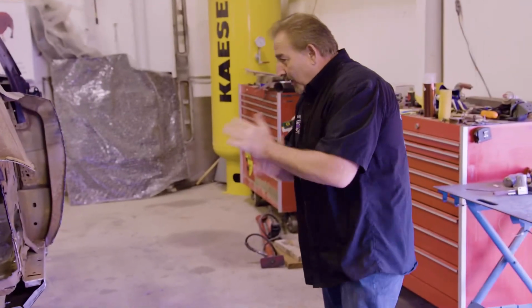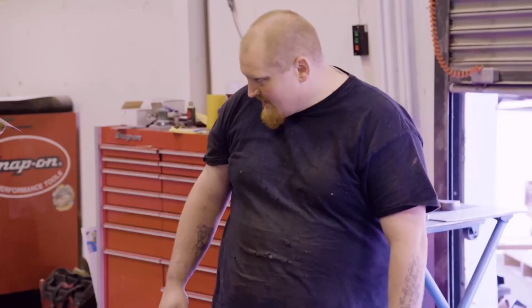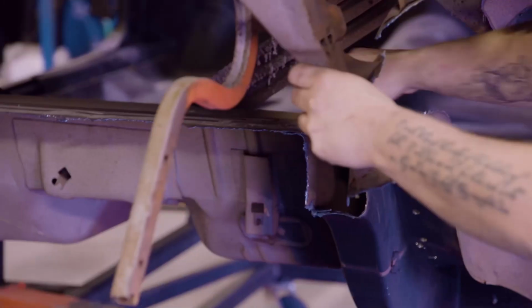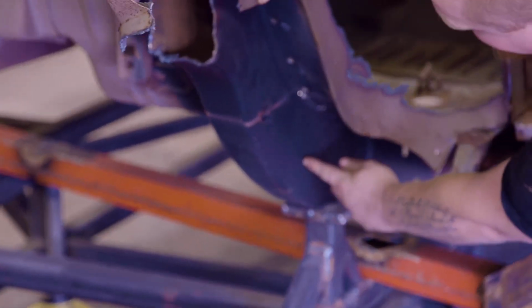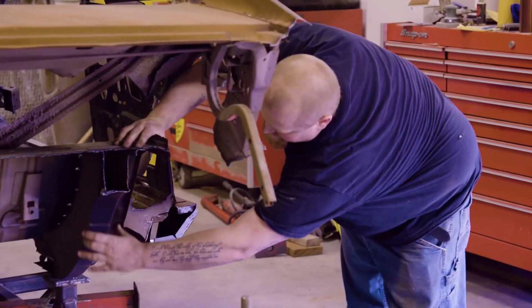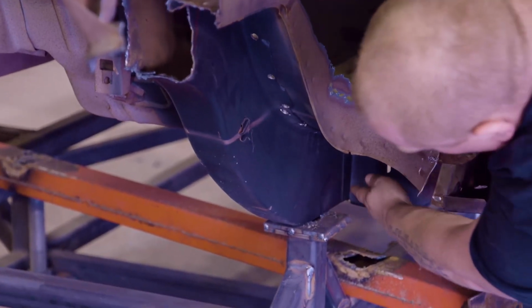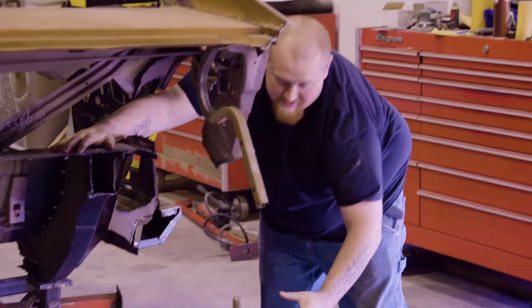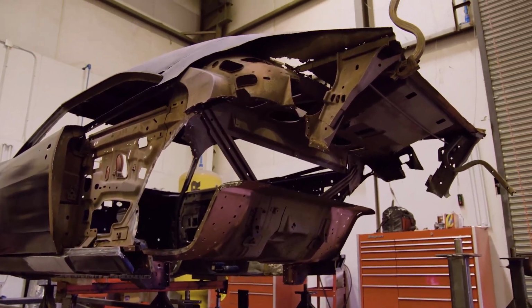All right. Well, with that, I'm going to go back up to my office and take care of some business. I'm going to start across this back panel here, removing this off of here, and then I'm going to go down through here and use the plasma cutter and trim this out slowly on both sides, kind of drop this apart from it, and then I'm going to jack it up and finish out the cut down through here, and then I'm going to start prying this apart from this back panel to put the new frame rail sections in. It should go pretty fast.